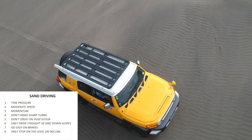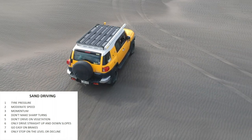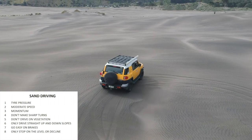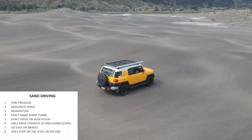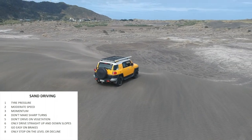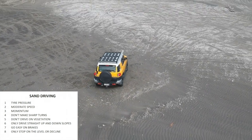I made this video for novice sand drivers or people that are a little bit intimidated by sand, tides, getting stuck, and all sorts of things that play in their minds. Sand driving is really great fun. The first thing is your tire pressure, which we'll talk about in more detail. You need tires deflated, a moderate speed — you'll notice I'm going fairly slowly — and momentum, especially on inclines.